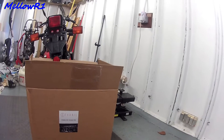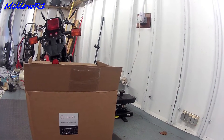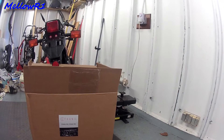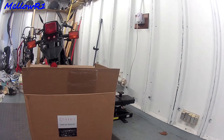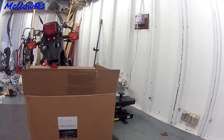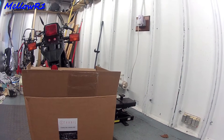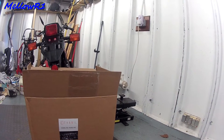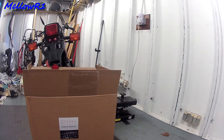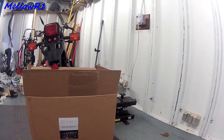Morning, pot pickers. Going to do a little video on removing ethanol today from petrol, because most pumps nowadays contain it. It's corrosive to some seals and plastics and can lead to fuel leaks and unusable fuel tanks. It's also a solvent which can loosen any tank sealing if you've got your tank sealed, and it loosens deposits in your fuel system, which can cause your fuel pump, fuel hose, or filter to block.